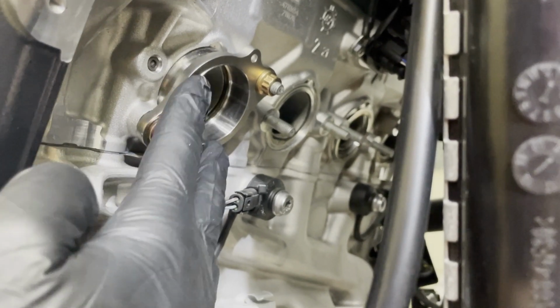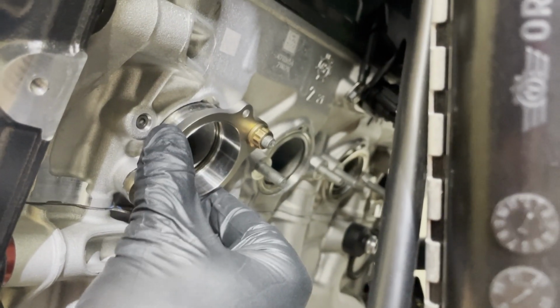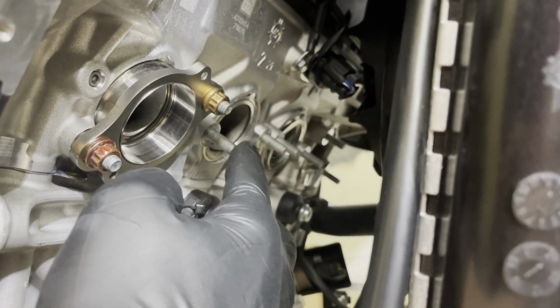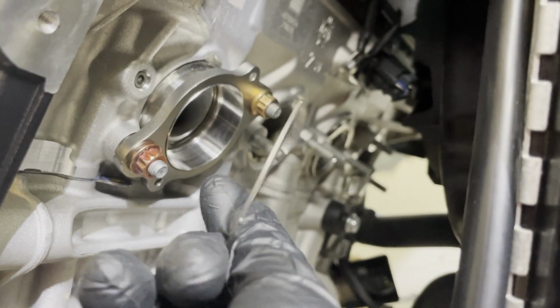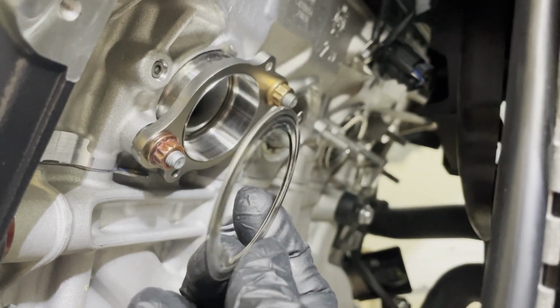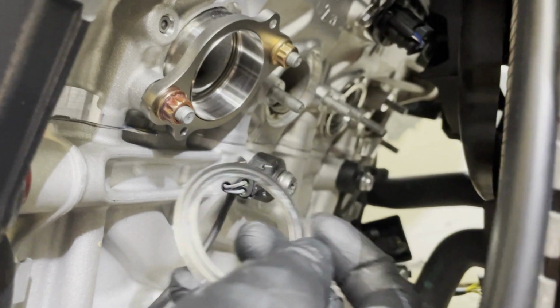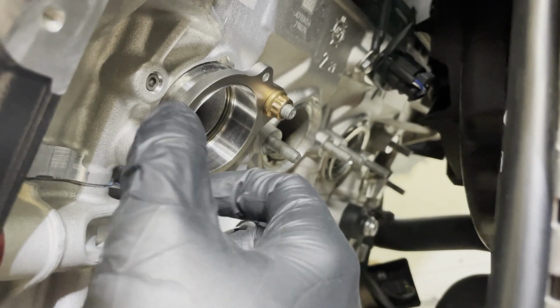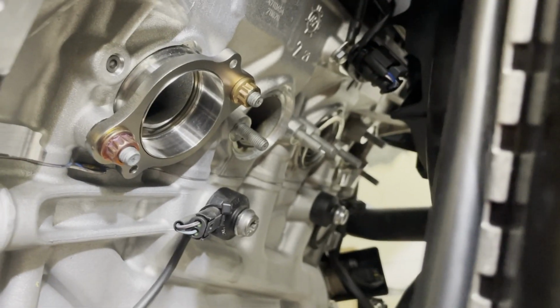Now we're gonna mount them just loosely so they can move around the titanium flanges. We're gonna do this on the other ones too. Keep the stock crush washer O-rings, these guys. Just keep them in place as long as they look good. This bike has only 800 miles on it now, so if this is not all crushed, you can reuse them. And yeah, just make it very loose here so they can move. And we're gonna do a test fitting with the new titanium headers.